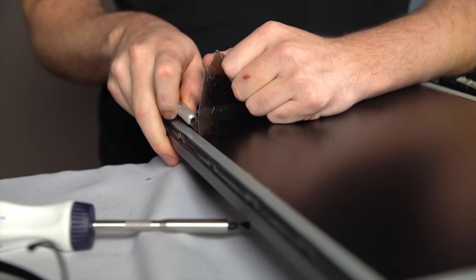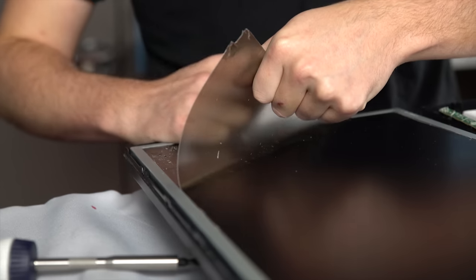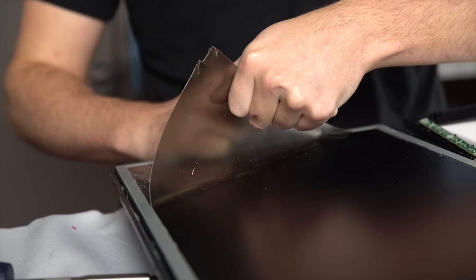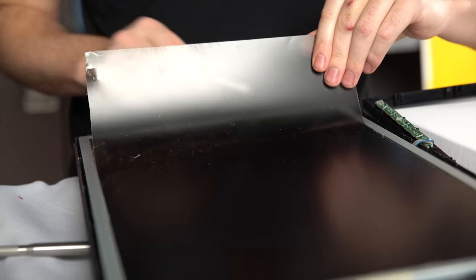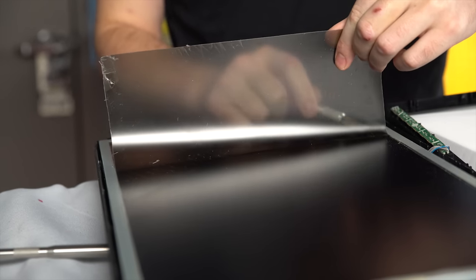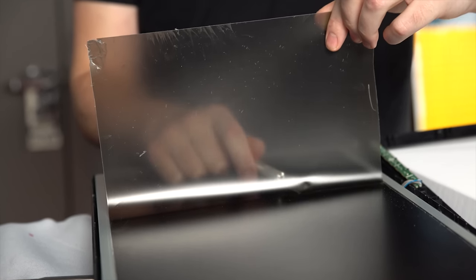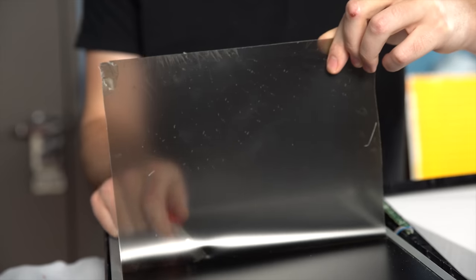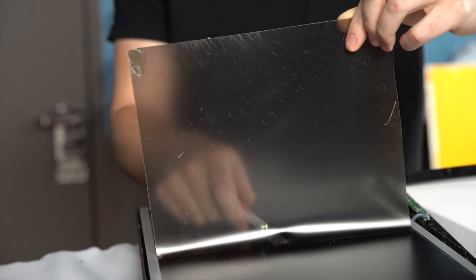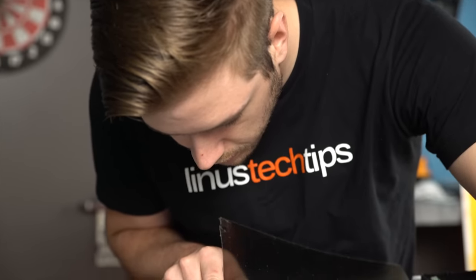Another helpful trick is to not necessarily pull the polarizing filter all the time and rip it off, but hold it up so you can get your chisel under there more easily. Once you have some room, it's much easier. I've got this whole side off and a bit of the top and a bit of the bottom — it starts to go a lot faster. This might not be the experience with every monitor; the amount of glue used is definitely different. The clean, sharp cut all the way around is helping me, which feels super sketchy while doing it but is actually totally fine.